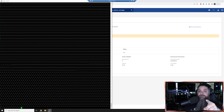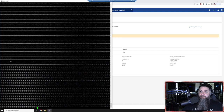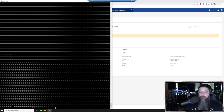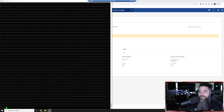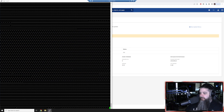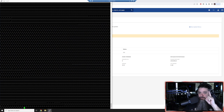We updated the BMC service processor and configured it for network access, and I showed you how to SSH directly into it to execute system power offs and ons without a console cable or jump host. It is going to save your behind one day. Make sure you configure that - don't skip it. Write down your IPs, know how to get access. I would just use the service processor to administer the system rather than the console connection - the more you use it, the less chance you have of forgetting it exists. It's your bailout from an administration standpoint.